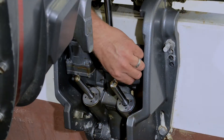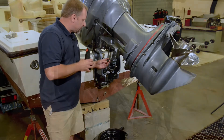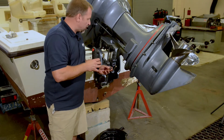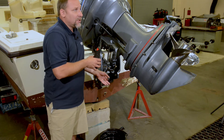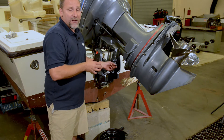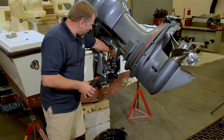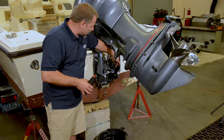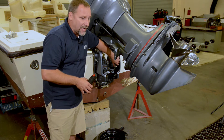Inside this cap is also some type of O-ring or washer. So if you take the cap off, you want to make sure that it's still there. I've been in situations where I've pulled the cap off and the O-ring fell on the ground. If you go to put that back on without it, every time you run the system up and down you're going to lose fluid and also cause a considerable amount of oil to go out onto the water — either scenario is not desirable.